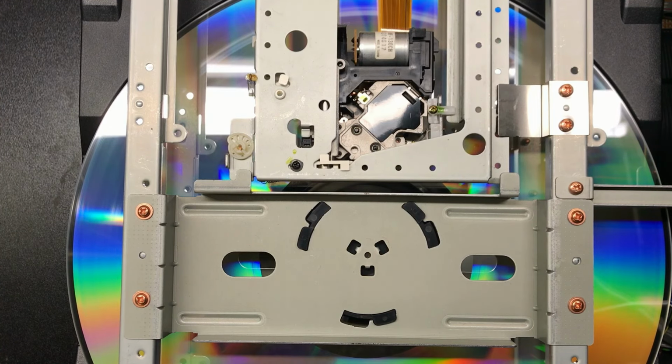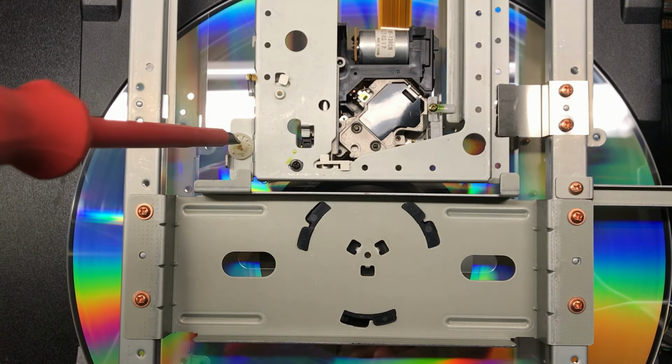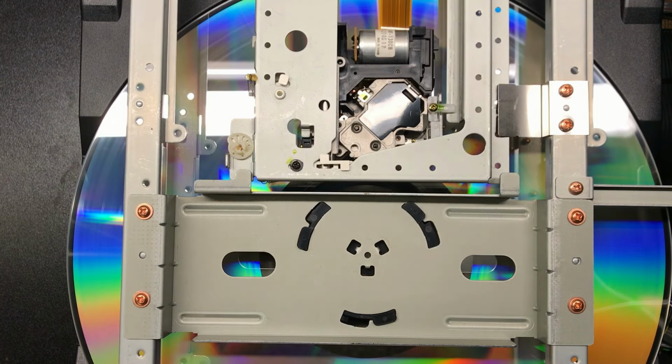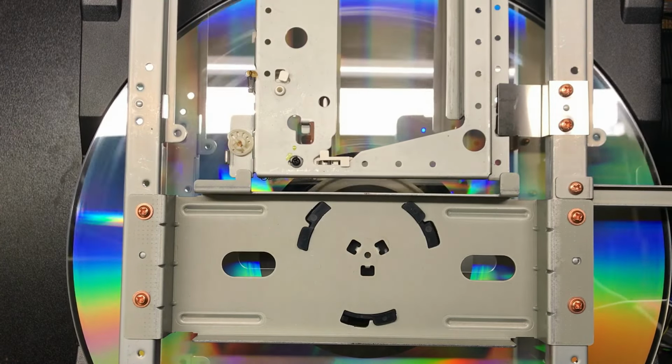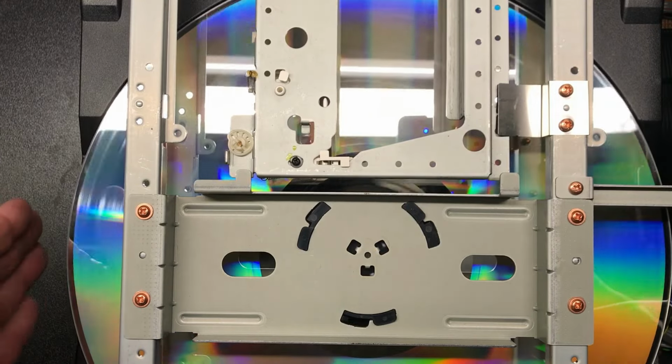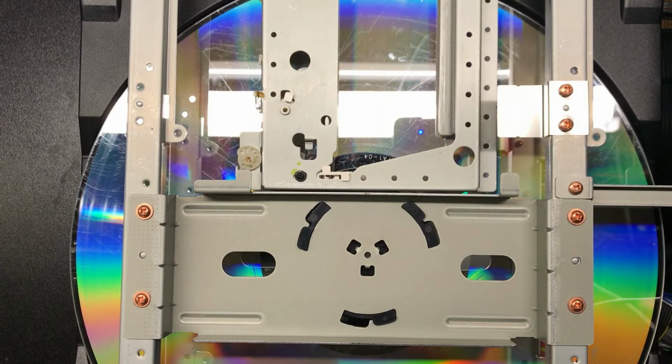When you adjust this, you want to watch out on skip back. And we're about 13 seconds in so far. No skip back. Normally it's about 30 seconds to 3 minutes. You'll see that skip back. But it's really fine adjustments on this thing. This is also another indicator, if this thing is really slow to spin down, then you have a grip ring problem.